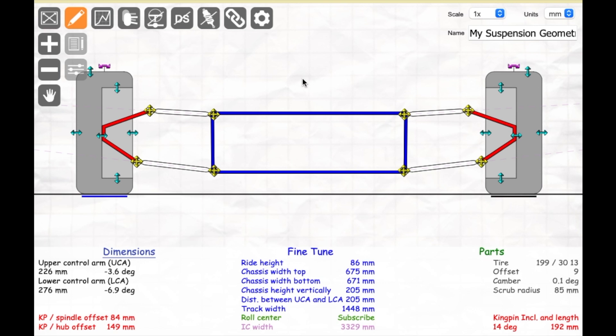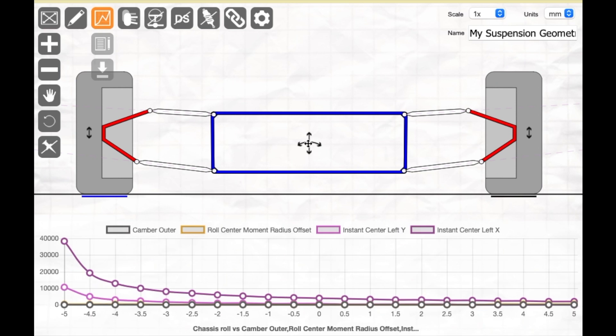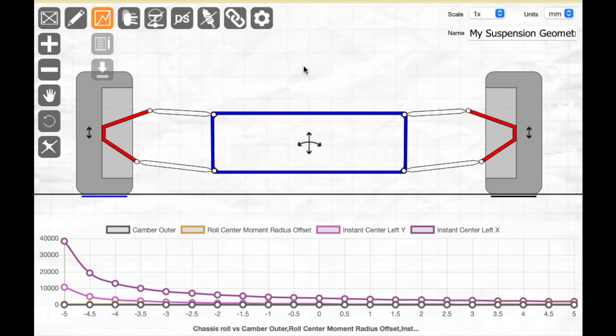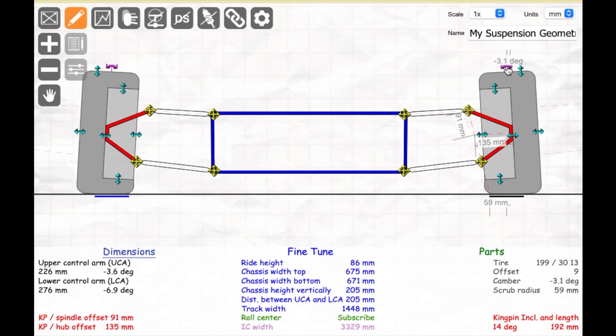Now let's look at the simulation. On screen we have the simulation of a race car — the blue lines are the shell or body, we've got the wishbones, all the dimensions you can set up, the tires left and right, and underneath the tires you find the contact zone between the tire and the tarmac on both sides. Right now we have about zero degrees camber. If we take a right turn, all the weight moves to the left — and see what happens underneath the left tire: the blue contact line gets smaller. We're losing grip.